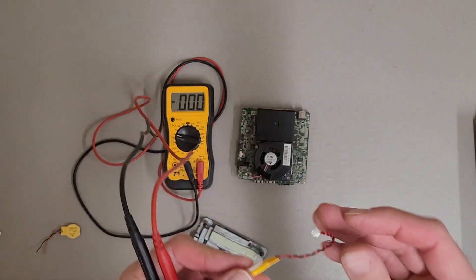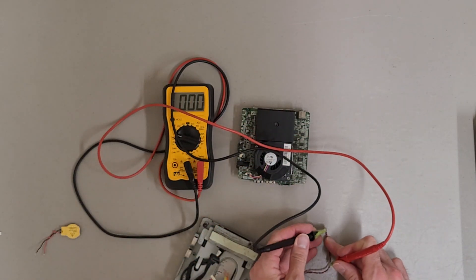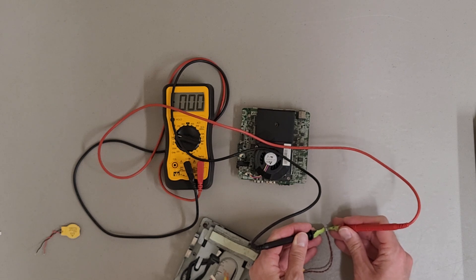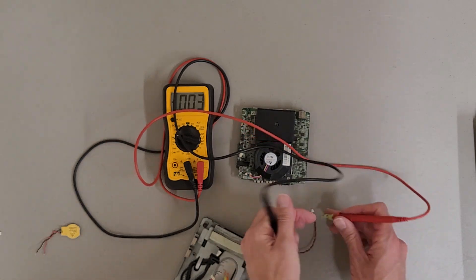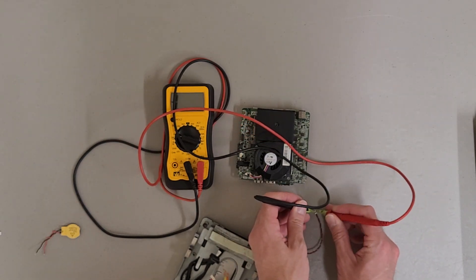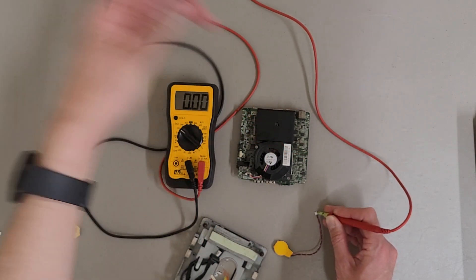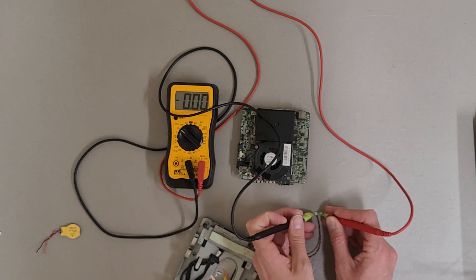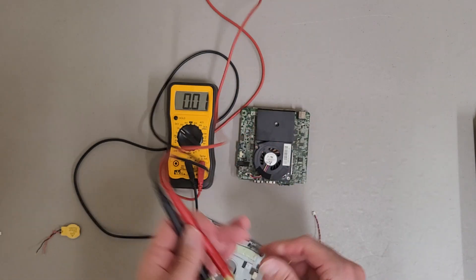Here's an actual brand new one. We're going to check the voltage on this real quick. This is an aftermarket part — it's just a CMOS battery. This isn't my best multimeter; it doesn't have auto-ranging. So yeah, it's reading negative 3.3 volts because I have the probes on wrong.